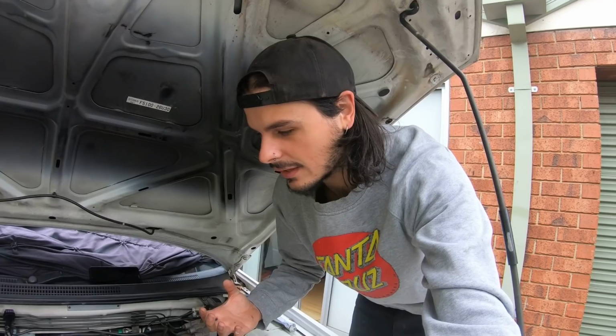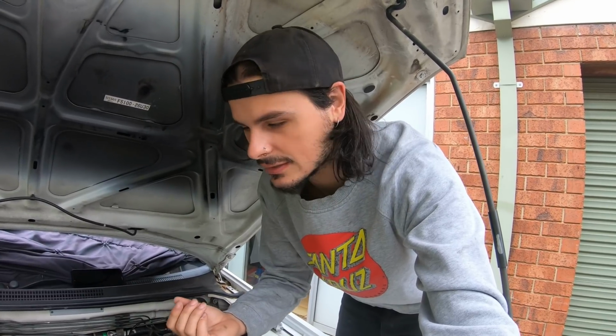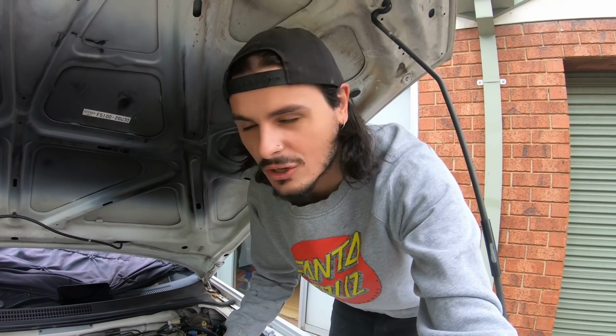And the reason why you want proper seals for the valve cover gaskets is because there's a lot of pressure, and you don't want oil and air seeping out of the gasket, going down the side of your motor, making it all greasy and dirty. That's why when I stripped my engine apart, my engine was so filthy. It was just dirty as.